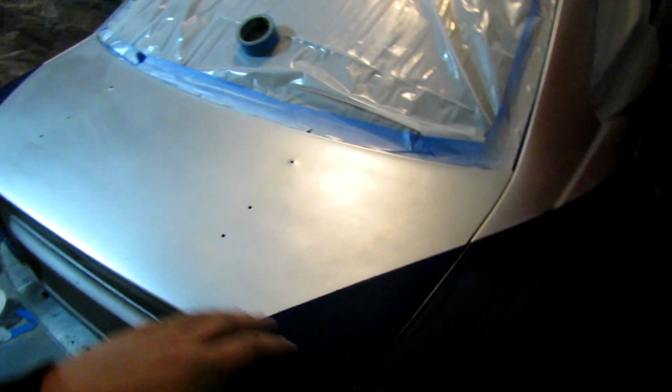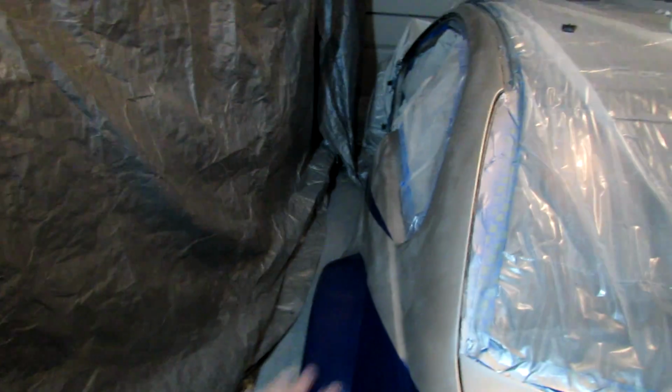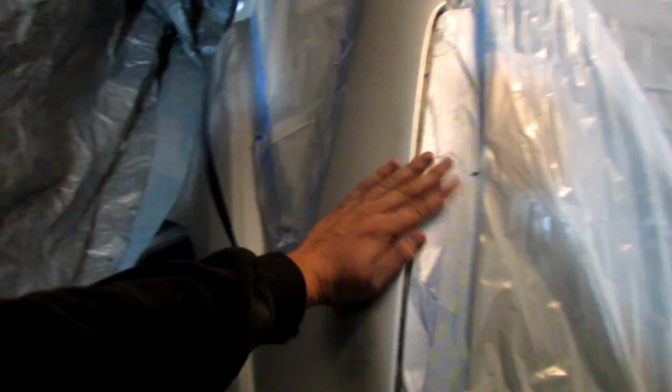So guys, as you can see, this is the blue, which is a plain color, and the metallic silver. You can do anything you want, silver, metallic, or non-metallic. They do have metallics in cans. Just a warning, metallics do cause blotchiness, where some areas have a little bit more flake than others. Right now this looks weird just in general because there's kind of dust from the metallic.